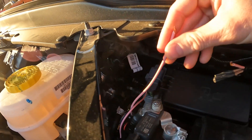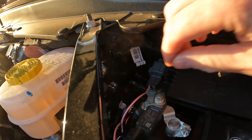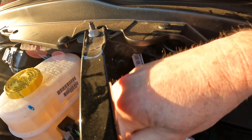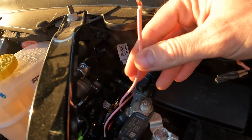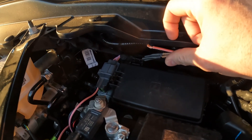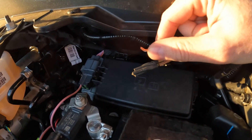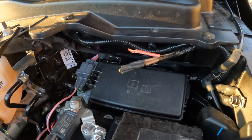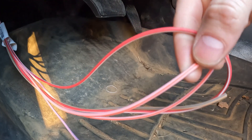The kit comes with a little jumper wire that plugs in under the dash. It runs the wire that terminates under the hood, through under the dash, loops it back into the wiring harness, and comes out at the back of the truck. I'm going to use one for backup lights, and run my fuel pump off the other one. I've already plugged in this pigtail wire into the bottom plug for the auxiliary switches.